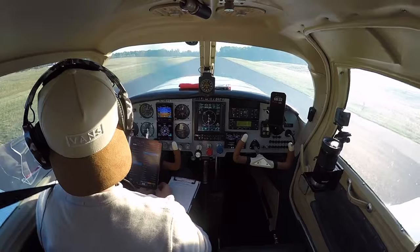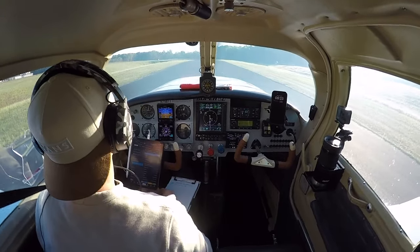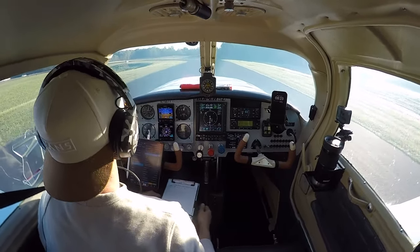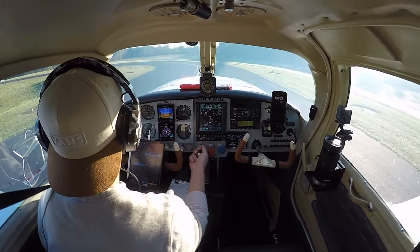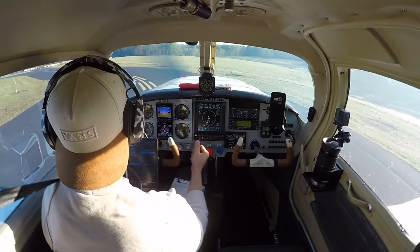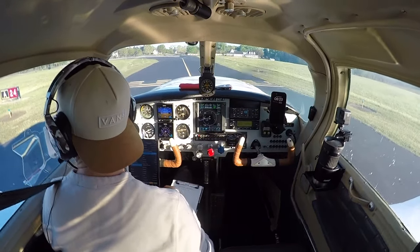All right, that engine oil is creeping up past 140 now, 141. I love it. My gauge usually reads 180, 185 in cruise, which you add 20 to that to see what the hottest temperature of the oil is. And basically you want that to be over 212 degrees so you boil off any moisture in the oil, because the spot where the oil is measured is cooler than the hottest spot. Boy, I'm not articulating that very well, am I? You get what I'm trying to say though. If it says 212 here, you add 20 and it's like 240, which is kind of hot.